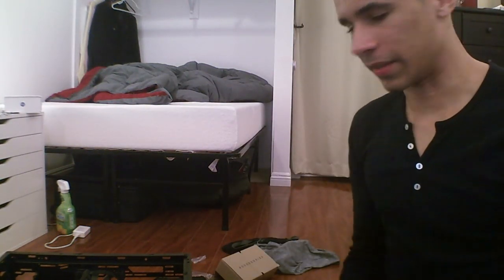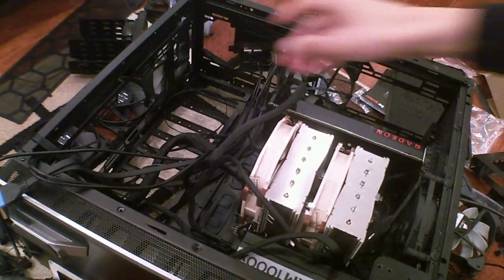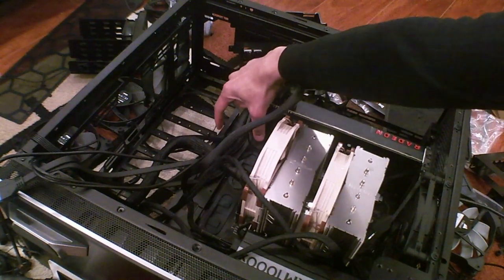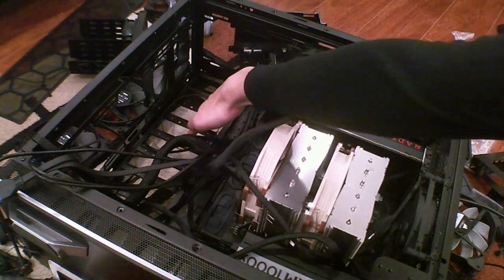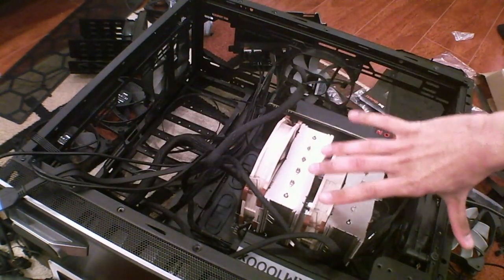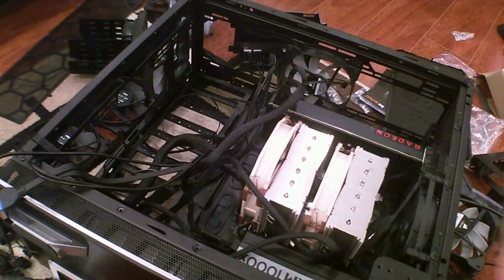Let's take a look inside the case. We'll have the hard drives in the bay. I also think this might be upside down — there's a significant gap between the motherboard and the hard drive base that I think is supposed to be between the fans and the drives. I probably mounted this upside down when I inverted the motherboard last night, which was only streamed on Facebook.